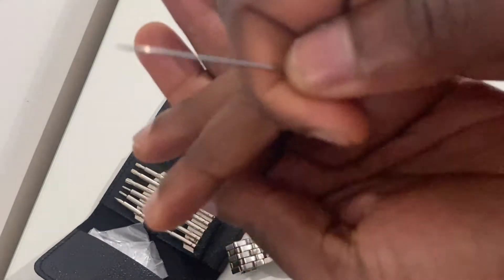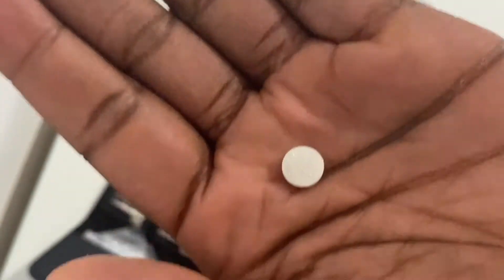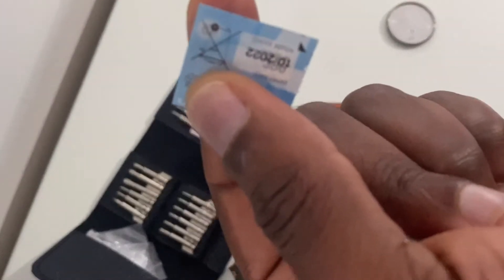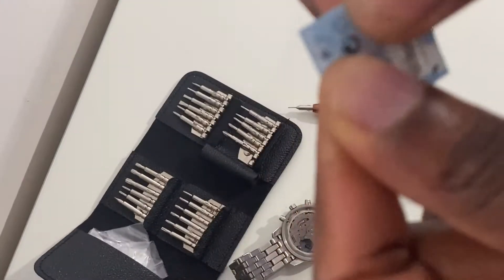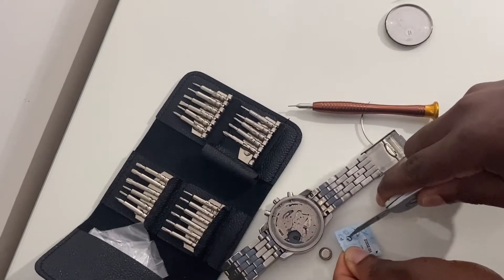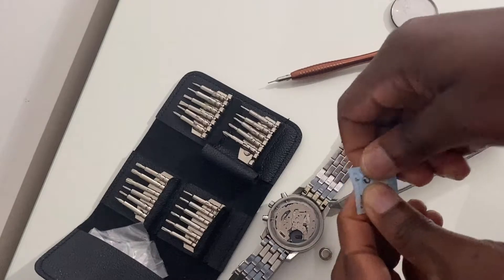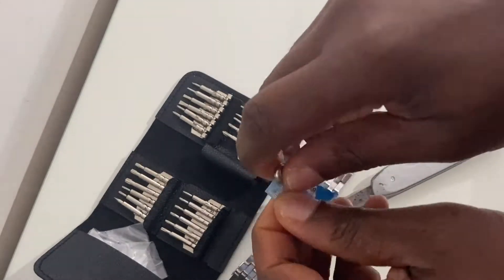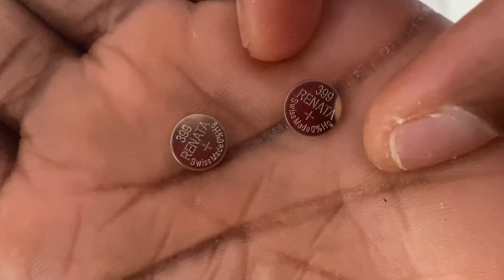I'll push the spring against the lever to get the battery out from underneath the bracket — and there's the battery. Sometimes you get the same model number on both batteries but it doesn't necessarily mean it's genuine, so it's a bit of a hit-and-miss with aftermarket batteries. Read the reviews and see the feedback from customers, but I'd still recommend getting it directly from a rated supplier.